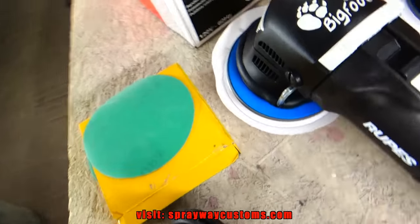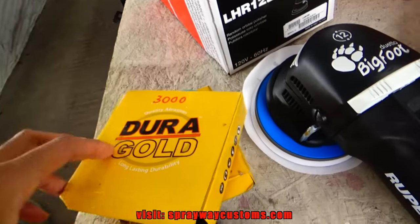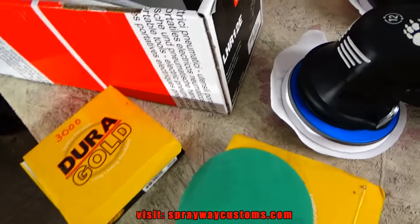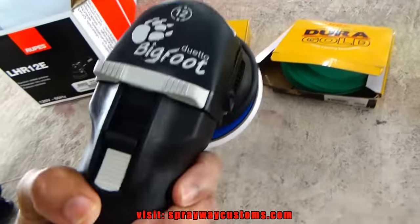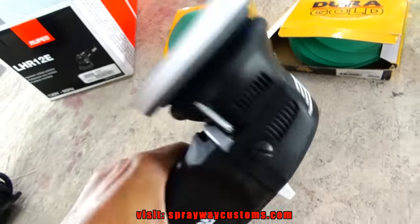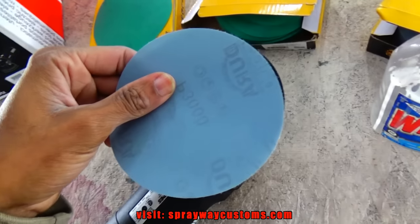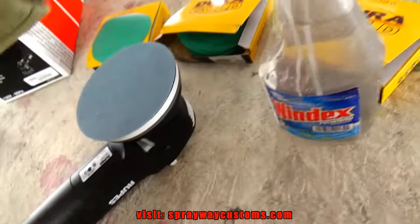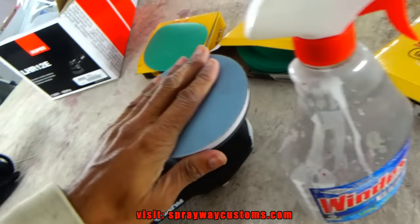I think I'm gonna just go straight to 3,000, see if I can get away with that. I've got it right here. But if I can't, I'll drop down to 2,000. So let's get everything set up and get started. All right, we got the Duetto. I guess that's how you pronounce it. We're gonna try to go with this 3,000, so we're gonna put a sheet of 3,000 on it. We'll make sure it's centered and see how good this is gonna cut. And we ain't gonna actually be wet sanding, we're gonna be damp sanding. We're just gonna mist this water onto the surface and cut it.